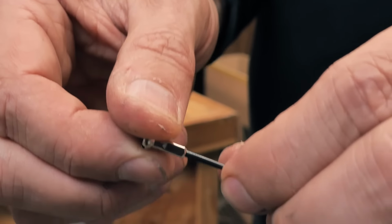So you will find that the hub, the spokes and the rim all have a maximum and potentially even a minimum kilograms of force rating. So the wheel builder has to take all of that into account, true the wheel, and make sure that all the spoke tensions are balanced and within the safety ranges. And then a really experienced wheel builder can probably fine tune that spoke tension within all those parameters and then start deciding what sort of tension the rider wants.